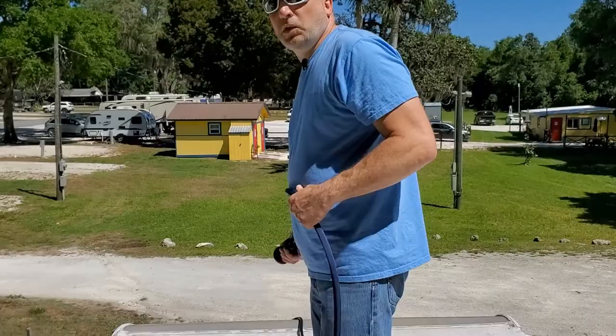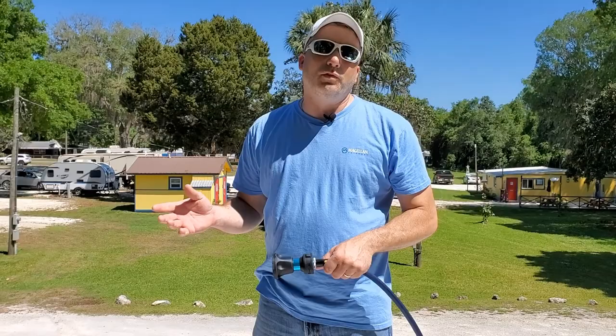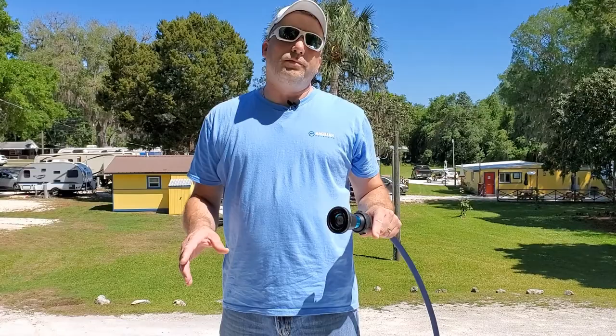Now that we've made it to the front of the RV, it's all rinsed off and wet. We're going to start and do a four-foot by four-foot section — pretty much half of this, four foot this way. We'll use our brush, spray the solution on, brush it really good, rinse it off, go to the next section, and work our way all the way back to the ladder and let it dry. Depending on the severity of your roof, you might get some chalky white residue that comes off down the side of your RV, so you might have to clean the outside too — but it's really not that hard, especially when you have that brush.